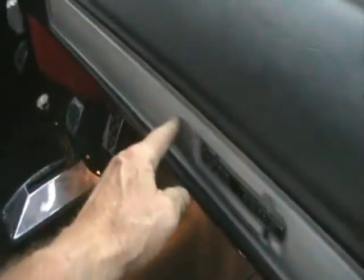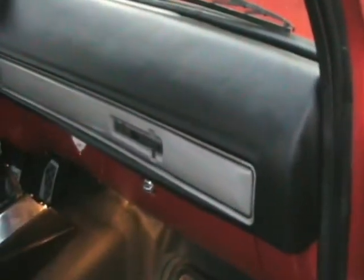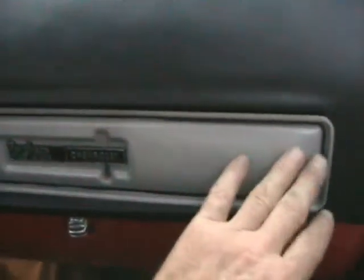He kicked this thing and it was just all dented and beat in, and I drove it that way for years. This would have been wood grain tin — simulated wood grain — but it was all beat up. So I took it off, laid it upside down on the workbench on a towel, and I got one of those old round casters from an office chair and started rolling that out. Lo and behold, rolled all the dents out pretty smooth. Then I stuck it in the sand blaster, frosted that aluminum, put some clear on it, and ran a little bit of pin striping around in there.